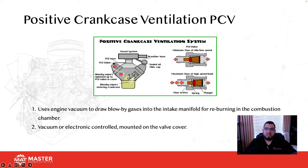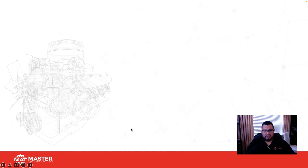One of the ways you could do this is pull the dipstick, and if the squeal goes away, it's a bad PCV. The other way we've done it, and we learned this from ATG, is using propane around the bell housing. If you run propane around the bell housing and RPM increases, then that propane is actually being drawn in through the rear main seal, and that's letting you know that the PCV system is actually shot. Okay, so that's one way you can actually test as well.